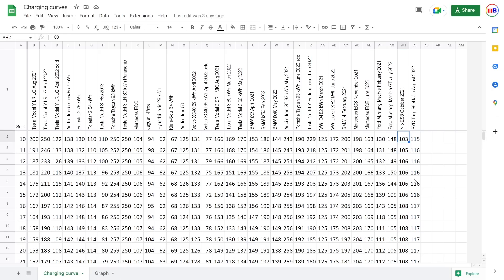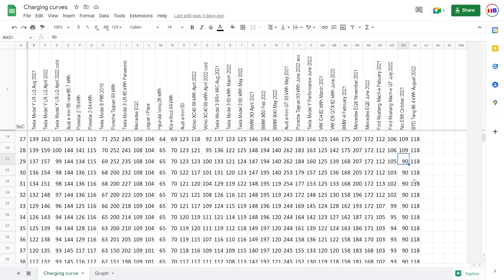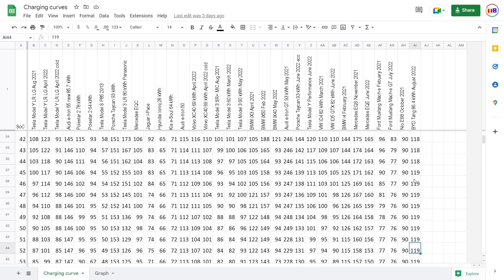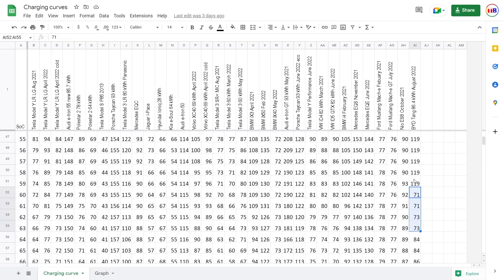The ES8 is supposed to have 125 kilowatt at the bottom, so we have to recheck that. But really impressive — at least after a while, the ES8 dropped to 90 kilowatt, and then the Mustang also has a slower drop. But the Tang just goes like a boss — 119 kilowatt flat all the way. I would say this is the thermal throttle. It should be 119 kilowatt until 63% until it throttles. Really impressive to take 119 kilowatt — how many other cars can do that?